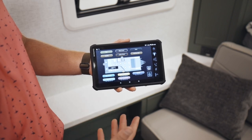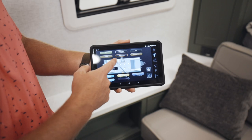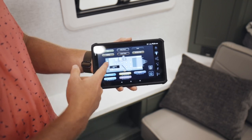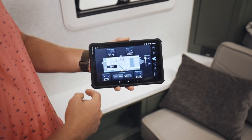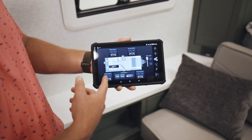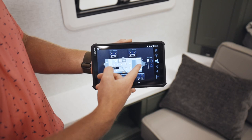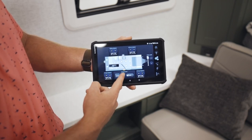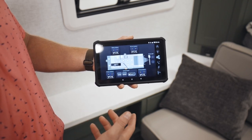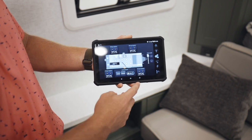The next page is essentially all your lighting. You can just touch one of the lights and it'll turn off and on, and you can dim those lights as well. These are all your exterior lights — if I want to put on an amber porch light, I just click this button and the outside light by your door will turn a nice amber color. The following page is for your stabilizer jacks, your front jack, and your awning. You can manually lift up or down any of the four jacks, and you can control your front jack up or down. This is also for your awning — you can extend or retract it, and it even has a wind sensor mode with low and high sensitivity. If it's a super windy day on high sensitivity, instead of the awning floating out there in the wind, it'll actually retract itself back in so you don't have to worry about any damage from the wind.